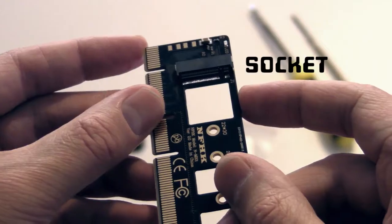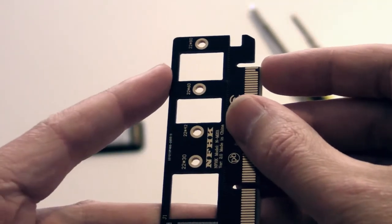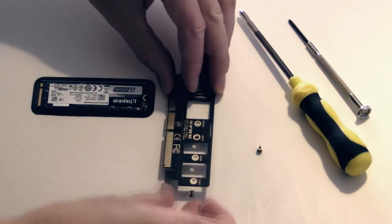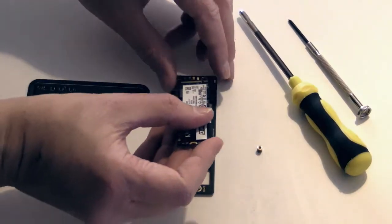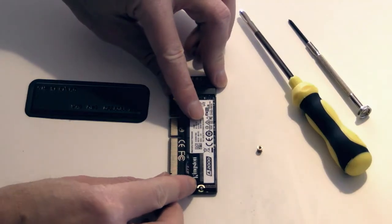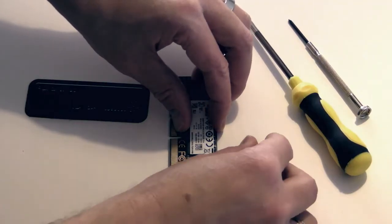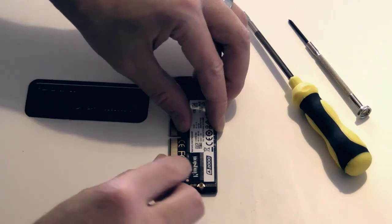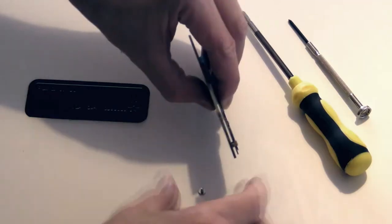The tabs fit into the black plastic socket. Then the screw and barrel fit in one of the holes and hold the SSD in place. Put the screw in first to check you've chosen the correct hole. Insert your SSD, then place the barrel connector into the socket in the end of your SSD. Turn the adapter over and tighten the screw until the SSD is secure.